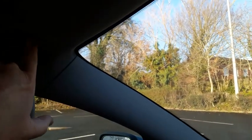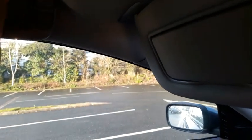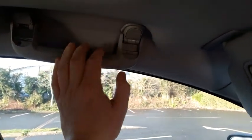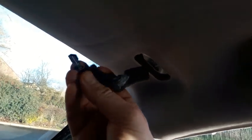I'll show you on this side. You just take this — there's a cover there, there's a cover there that just pops off. There are two screws under that cover, and then there are two eight millimeter bolts here, there, and there. They pop off and then all of this comes loose like this. You have to disconnect the mirror wire out of the sun visor, and then this all pops down and you can drop the headlining down.